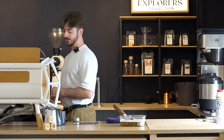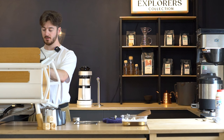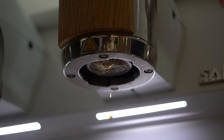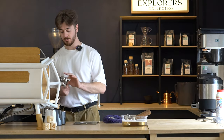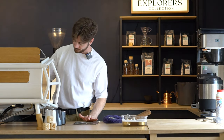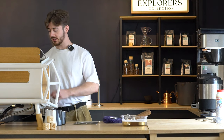Otherwise you can do it manually and it's pretty simple. What we're going to do is five pulses of five seconds. Using your manual shot button, just start a shot for five seconds, then off for two, then on again — repeat this five times. Once that's finished, remove the portafilter and give the group head a purge through. Remove the blank, put back your regular basket, and give it a quick purge again. The back flush creates a pressure vacuum so it sucks all of the cleaning powder up into the group head, giving it a nice deep clean on the inside.